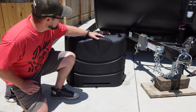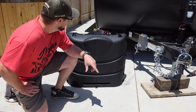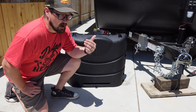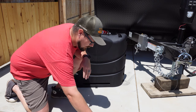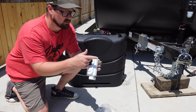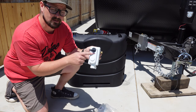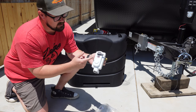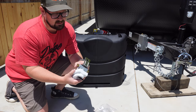For our setup, I went ahead and picked up the Camco dual LP gas propane tank cover. I'll put all this stuff in the description. This one can do either two 20-pound tanks or two 30-pound tanks. I opted for the 30-pound option because in the future I might put 30-pound tanks on this — just a little bit of a height difference. The regulator I got is actually an auto switchover. I can designate which tank I want it to pull from first. It's got a viewing window that tells me when one's empty — it switches from green, which is good, to red, which means you're out. When it turns red, that tank's empty, but it will automatically switch over and draw from the other tank. No more getting up in the middle of the night to switch out a propane tank.